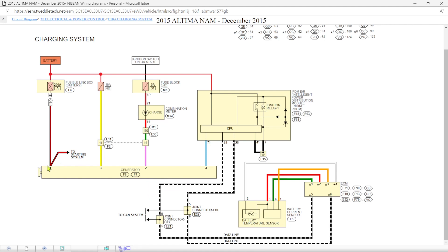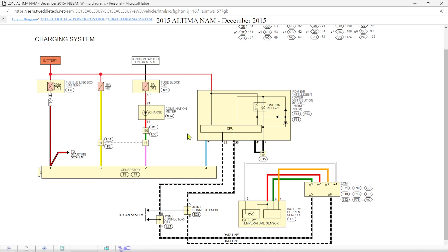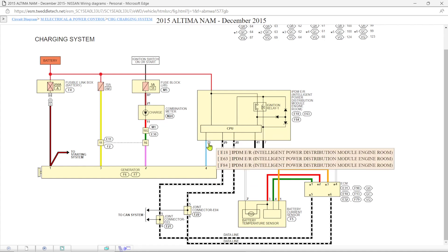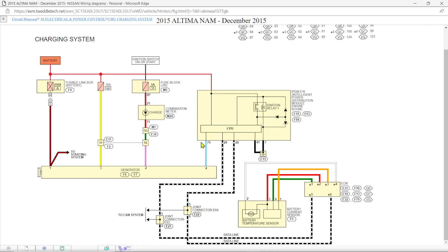So this is a pretty standard diagram. You've got your big wire here — that's what goes to the battery and carries all your current back to it. This is your sensing circuit; this wire needs to be 100% load tested with no resistance in it. This wire here is for our charge light — you have source voltage here and alternator output here. If output gets less than source voltage, you have a ground path that turns your battery light on. This wire here is the signal from the IPDM. It's a pulse-width signal, negative duty controlled, and it will lower or raise the output of the generator.